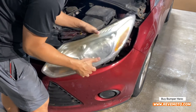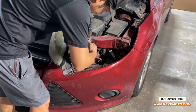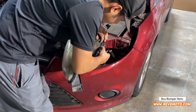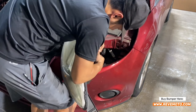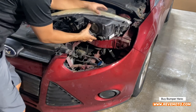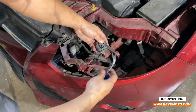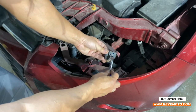So you can see it's really easy to take off. Then come here and take off this wire harness right here. It should just be pushed down on it — sometimes it's really on there. This one's a little brittle and it's stuck on there. What I did is just wedge my flathead on there — got a flathead like this one and just kind of wedge it down here and then push down on it, just like that, and it comes out.